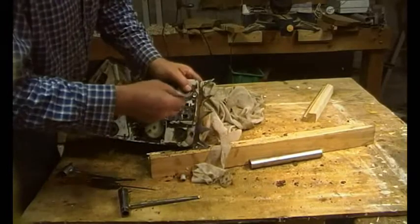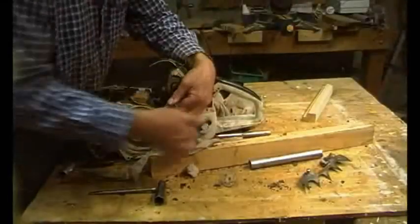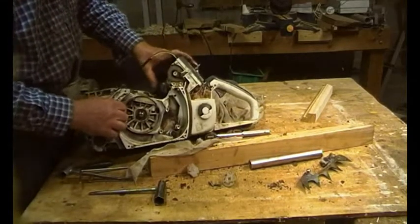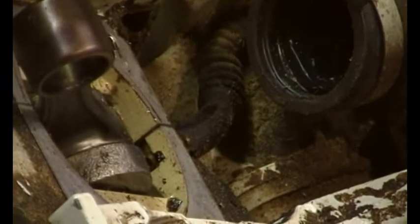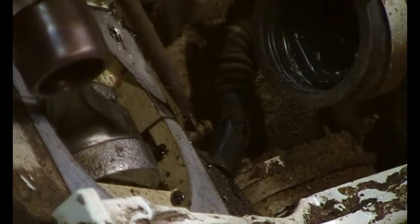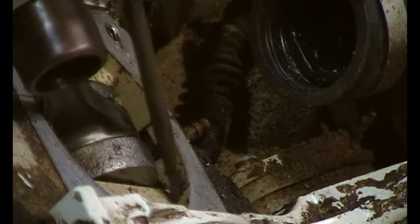We'll get rid of these felling dogs. Now let's do the rubber mount this side - those two are removed. Then theoretically the only thing holding this together is the vacuum pipe. Let me show you the impulse pipe - there it is, that concertina thing. It just fits on a spigot. This is something you would definitely replace with a new one when you're in here. This makes the diaphragms in the carburetor pump fuel, so if there's a leak there you're into a few problems that take quite a lot of diagnosing.